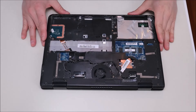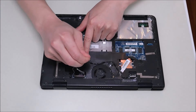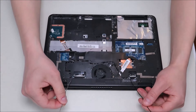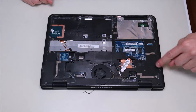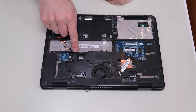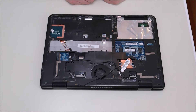To continue further into the computer there are several screws everywhere that we're going to have to take out. You also have to take your antenna wires and run those out of their channels to where they enter — the black one goes to one slot, the gray or white one goes to the other. You'll see screws in multiple locations across the interior. You don't have to do the CPU heatsink screws yet, but remove all the other screws to get further into the computer.